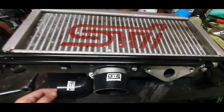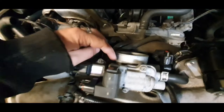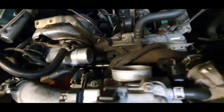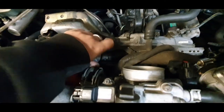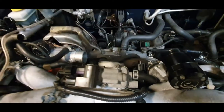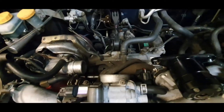Always have the GrimSpeed logo facing up. This one might need a bit of tweaking to fit right. Always clean the throttle body — clean all around the outside with an alcohol wipe or anti-static wipes from a spray painter. The reason you find oil in the turbo is because the PCV valve is somewhere down there at the back of the throttle body — it goes into the intake, sucks in oil, fills your intercooler with oil, which causes pinging and ultimately a hole in your piston.